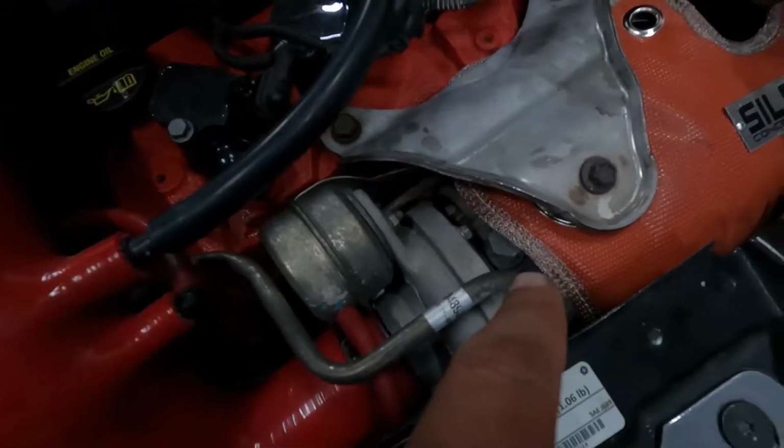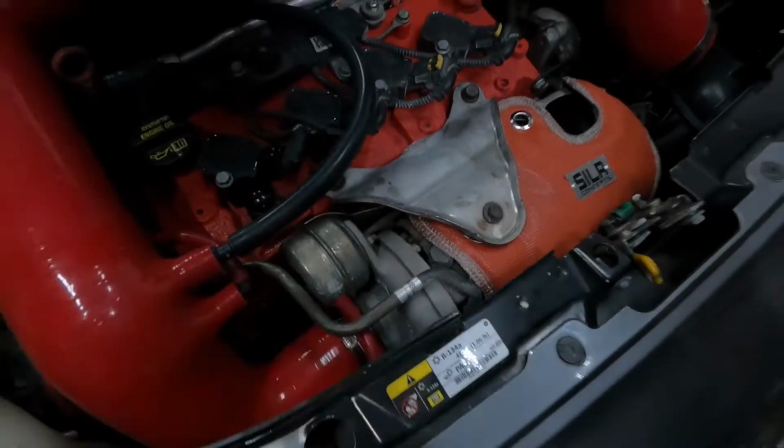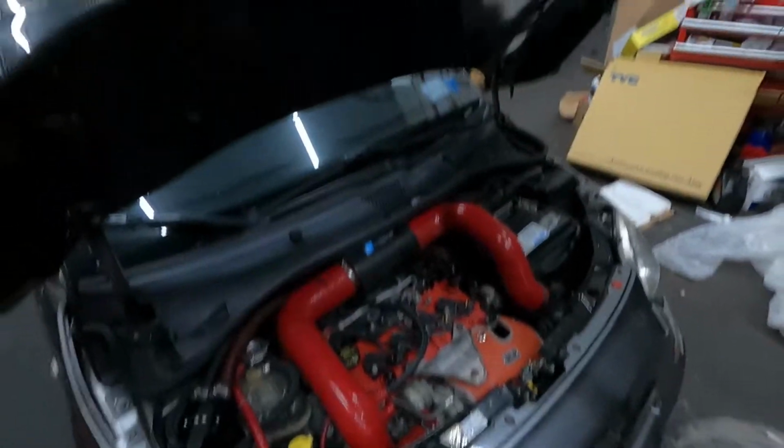It is 3:03. When me and Akira were putting on the turbo blanket, we unplugged the O2 sensor. Kind of forgot to put it back. So we started it. It sounded like there was an exhaust leak, and I thought it was because of this clamp that's back here, or V-band, whatever you want to call it. No, they can't see it, but I thought it was from there because that's been an ongoing issue every time I take it out. The downpipe, that it's not very secure.